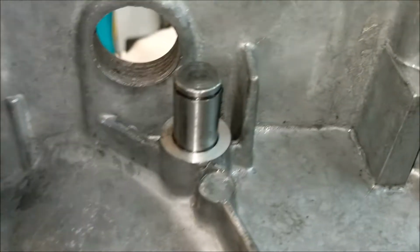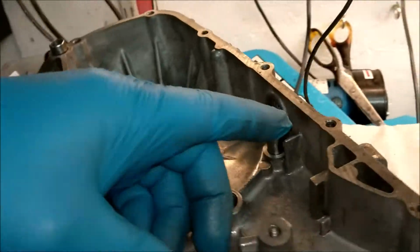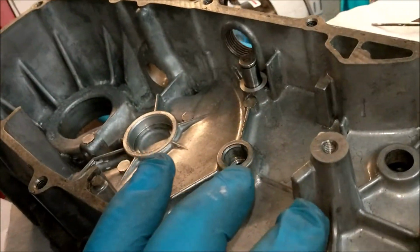Only after reading some literature on how to take it apart, after I'd actually done it, it says quite categorically to remove the tensioner and the guide, get your circlip pliers, and remove the little tiny circlip at the top. Then they should just slide off the pin. If we have a closer look, there were none on there, and there were no bits floating around in the engine.